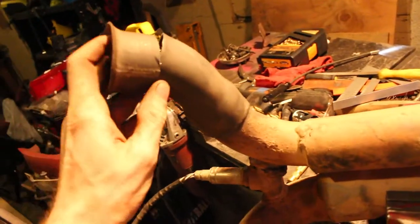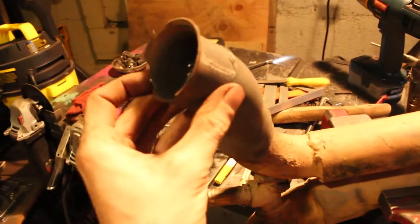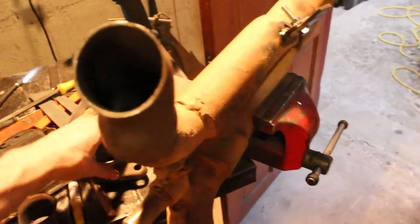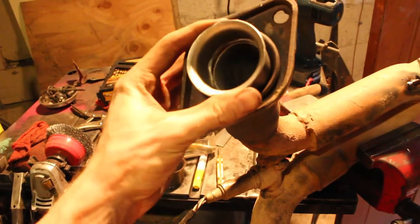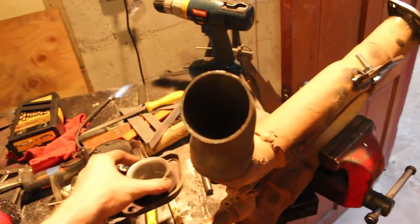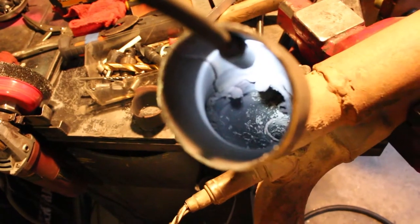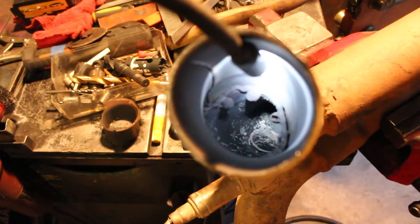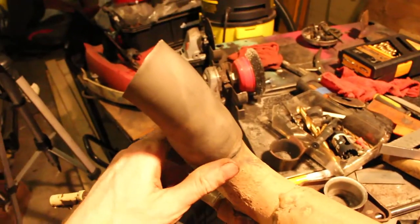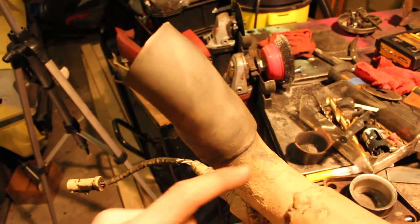You can see that this section right here has been replaced at some point — it's a different color than the rest of the exhaust, and they obviously did a bad job or something happened. We cut this piece off so that the guy could make this piece, which is pretty cool — he expanded it to slip on here so I can make sure it fits correctly, tack it up, and then fully weld it in. But down here, you can see when they repaired it, it looks like they cut it off with a cutting torch and just left those huge boogers. Since both are slip fits, I'm going to tack them both on at the same time, cut this off like I did for the catalytic converter, re-weld it on, and cut that nastiness off.